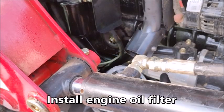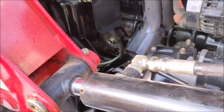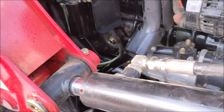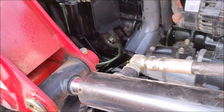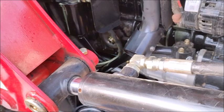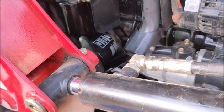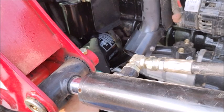A few filters done. Now the new oil filter. I'll take a little bit of the oil I've drained from the engine and put a light coating on the gasket — it doesn't need much. Being careful not to cross-thread it, screw it on until it seats, then another quarter to half a turn.